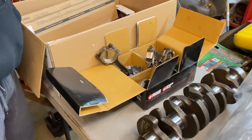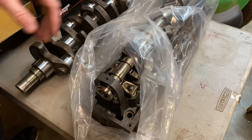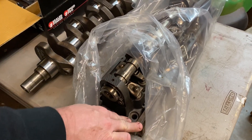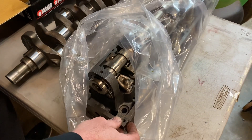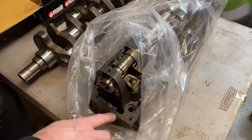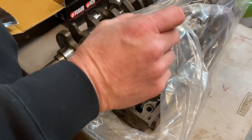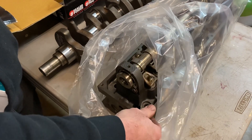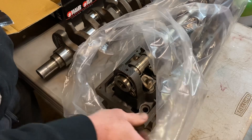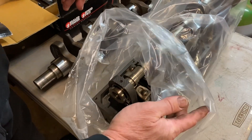Okay folks, we got everything in the shop now. Over here we have our cylinder head. Our other head had cracks in cylinder two and three in the combustion chamber from overheating. He found us a core head — the only difference is the thermostat housing is eight millimeter threads instead of six millimeter. We're going to do a helicoil repair on that to make those six millimeter. The head has been machined with new lifters and new cam bearings, so we're good to go.